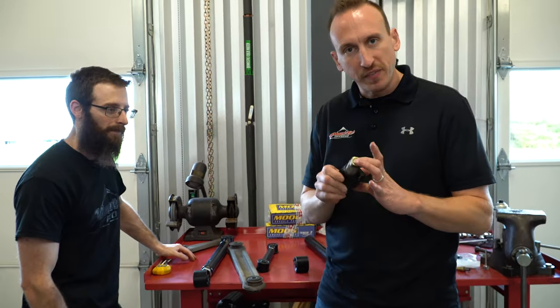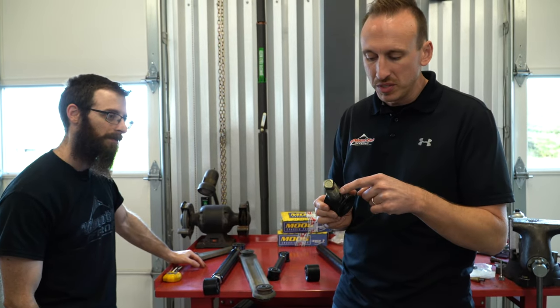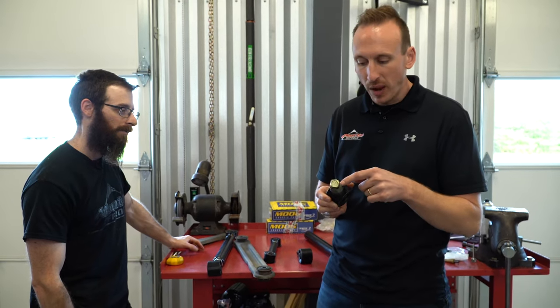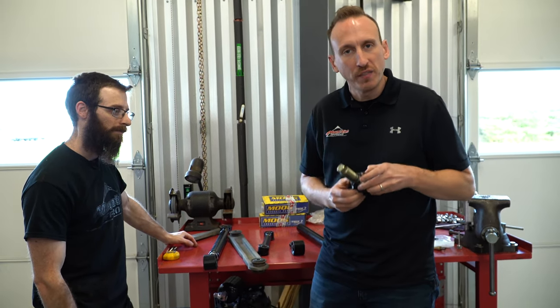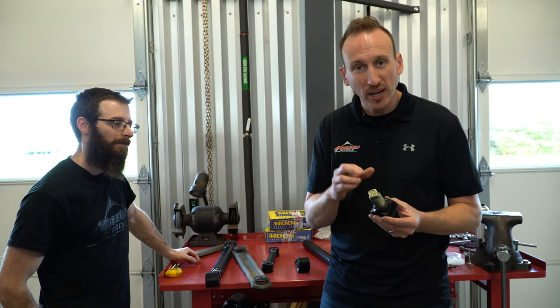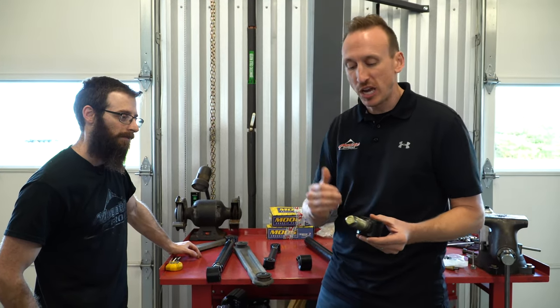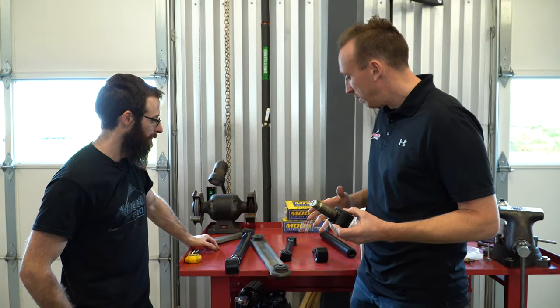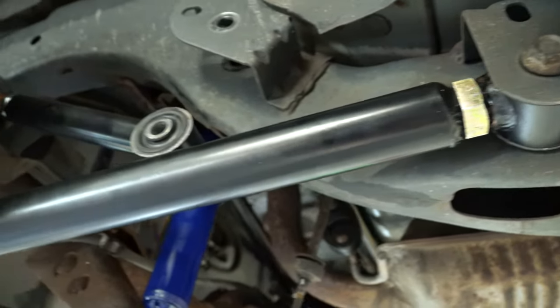And we actually called the manufacturer of this kit. This is a wheel stud. So it's 1 1/8 by 16 thread pitch, which you can't just buy an off the shelf jam nut for. So what we did is we bought tractor trailer lug nuts, sent them to the machine shop, and they are making them into custom jam nuts so that we can put it all together with jam nuts on both ends.